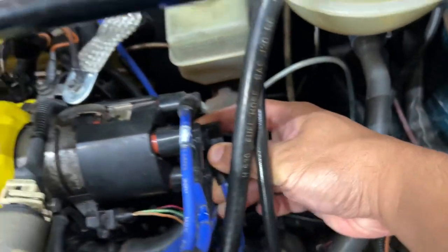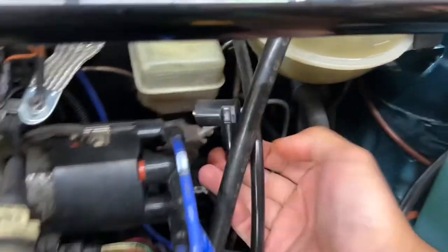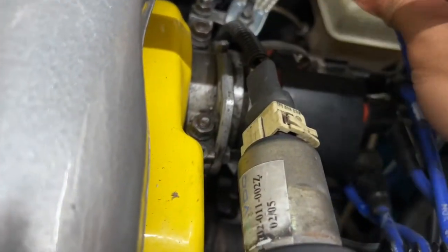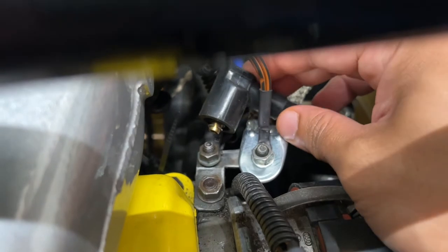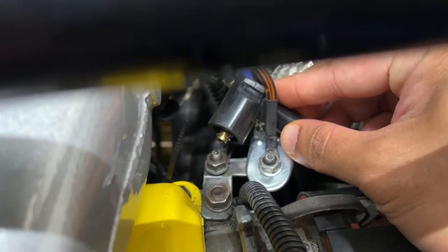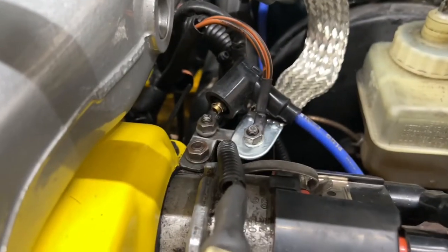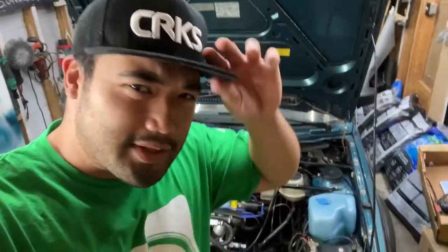So you take the spark plug wire going into the distributor from the coil, and you hold it close to a known ground, like right there by the head. Okay, and I'm gonna leave the camera pointed there. Just pay attention to what happens when I turn the key. As you can tell from that brief demo, there's no spark on crank.